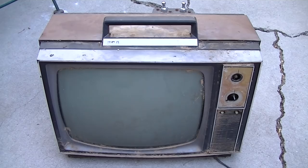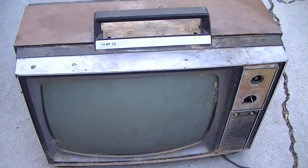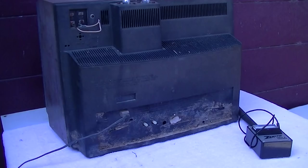What I want to do in this video is a quick diagnosis - let me explain that little brain failure right there. See, when you're doing a YouTube video and you look over and notice something, your brain tends to misfire a little. Back to the dark platinum mist: what I want to do is a quick diagnosis of the horizontal high voltage circuit and figure out why it's not working - is it the flyback, is it the horizontal oscillator? Let's go through how to diagnose a horizontal output.